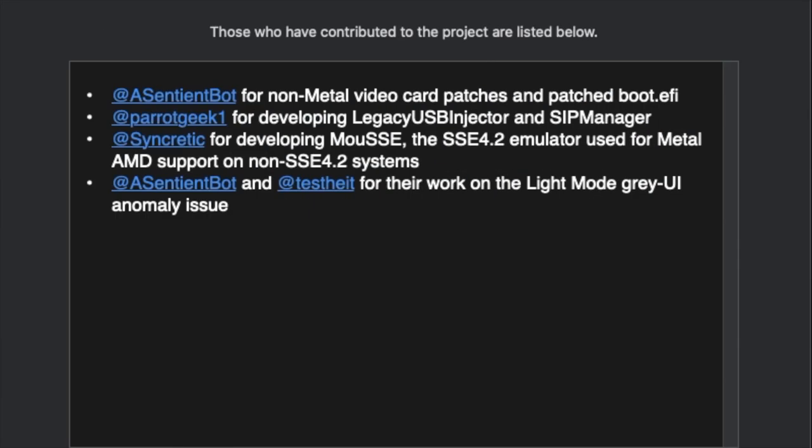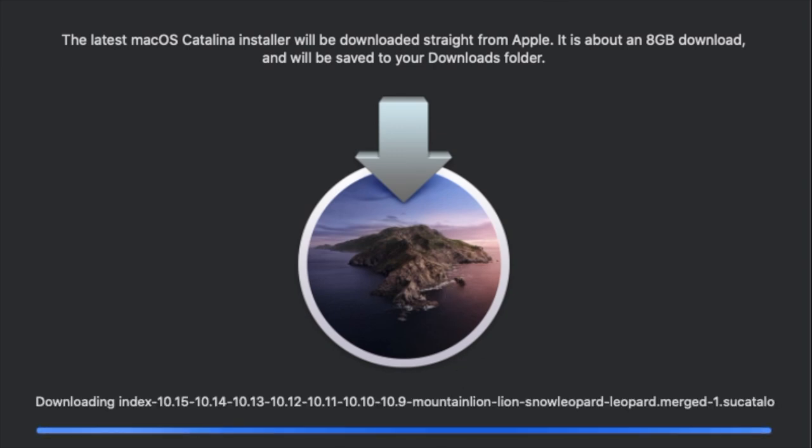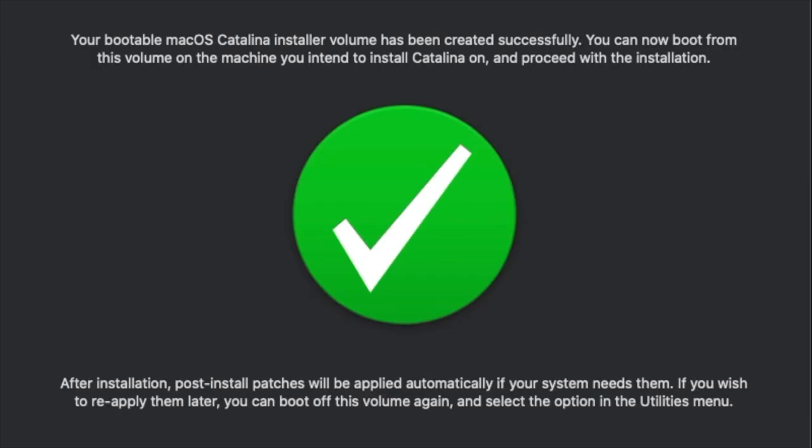To install Catalina, you will need a computer running macOS, a 16 GB or greater capacity USB drive, and Catalina Patcher by DOSDUDE1. I will put a link in the description. This patcher is made by DOSDUDE1, and running Catalina on this Mac is possible because of his work. He has a more detailed tutorial video. I will put a link in the description.